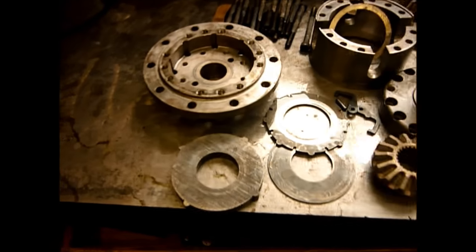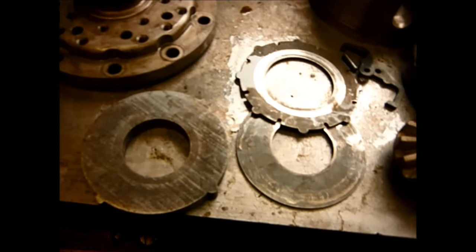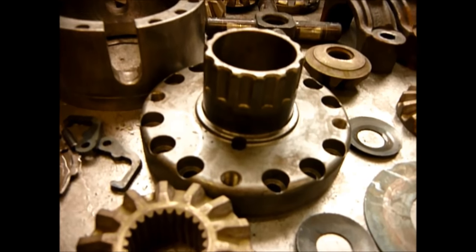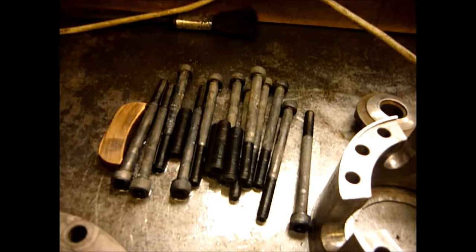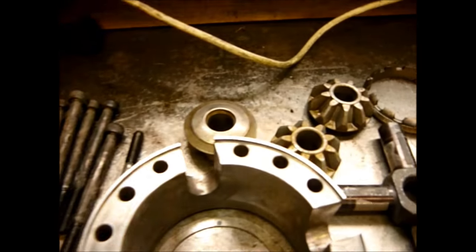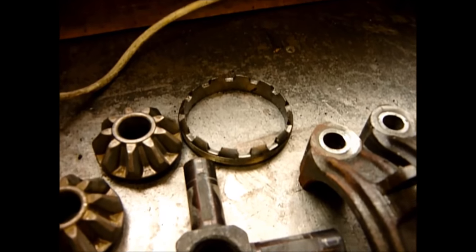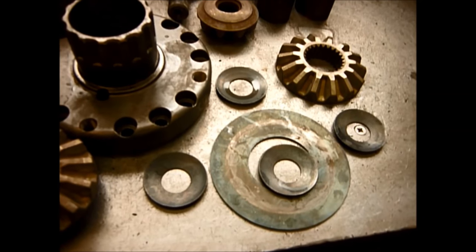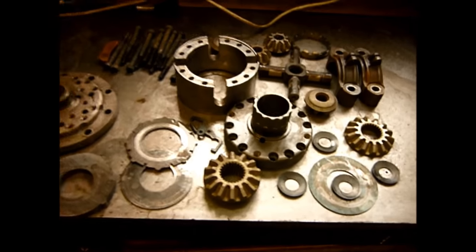Some considerable time later, we have clean parts. Here is the end flange which needs a new standard RTC 3095 bearing. We've got packers and spacers, cleaned-up gears, and the other flange which requires the special bearing. More spacers and dog ears. The centre piece with one of the shims, various nuts and bolts, and the phosphor bronze pad for refinishing. The forged centre cross shaft — which makes this a very strong unit — the special adjustment ring, and carrier caps. These are the four new solid shims without holes, which are the later type that can't crack. Now we just need to put the locker back together.